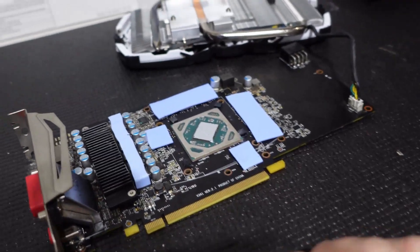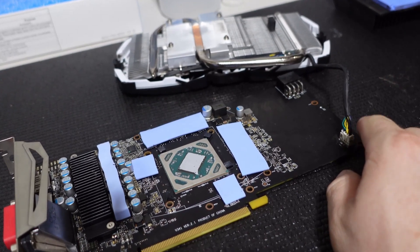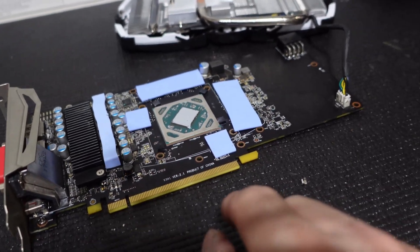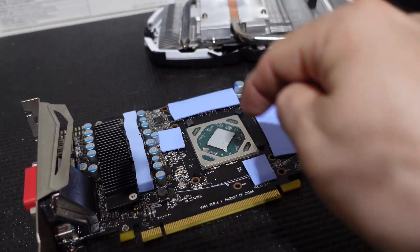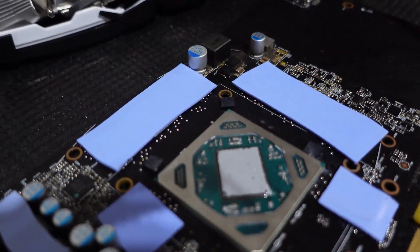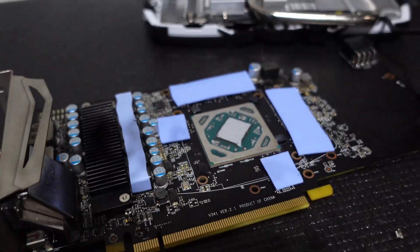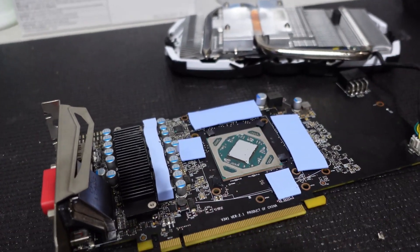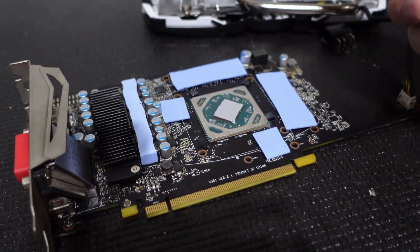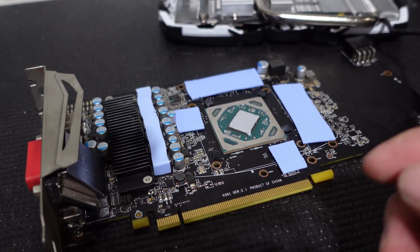We are set and ready to go. We're going to put the stock heatsink on. We connected the fan port, and we buttered this thing up with thermal pads — one, two, three, four, and five. We went ahead and painted on our Arctic MX4 thermal paste. If you're looking for any of this stuff, I'll put links down below in the description, including everything we used for cleaning. Let's go ahead and get that heatsink on, and then we'll be ready to throw this on our test bench.